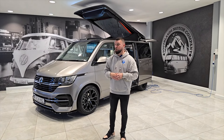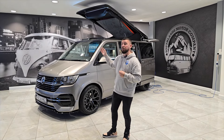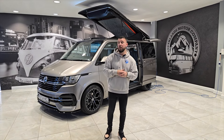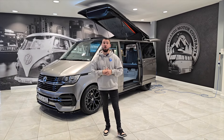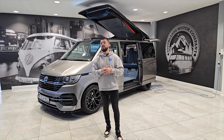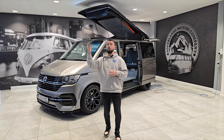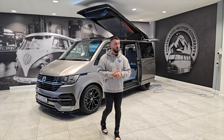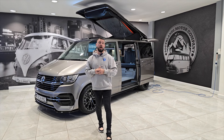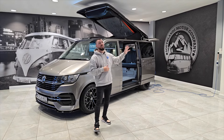Yes, the van has a battery-to-battery charger, and yes it has a solar panel — however, at this time of year it's getting dark by four o'clock and doesn't get light again until seven the next morning. We have very limited daylight, and more importantly the light quality is poor because of the weather. So the solar panel is only doing what it can, and it needs a little bit more help and support. This is where plugging your van in becomes very important.